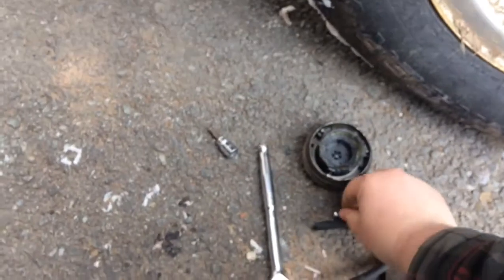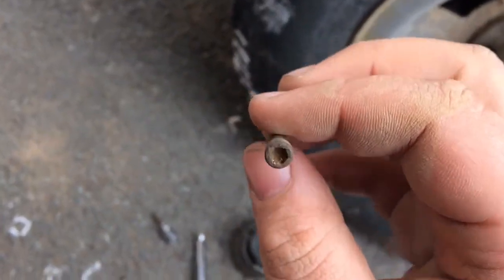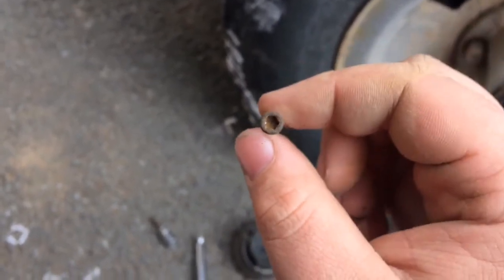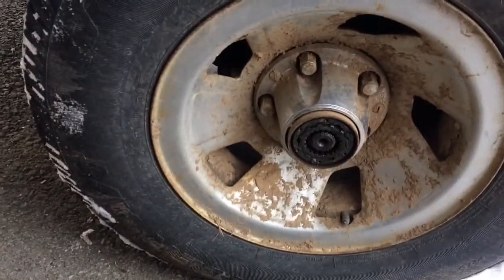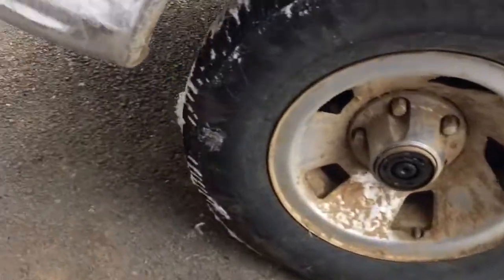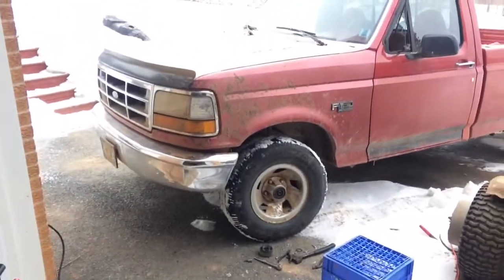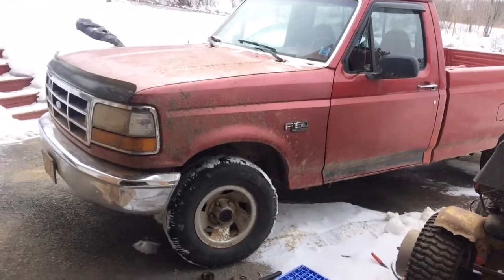But anyways, 6 bolts, T25. These ones are Allen head, but what you want to do is take the Torx head and beat it into here. That way they won't strip out. I haven't had an issue with it yet. I got my snap ring off, but it's cold as hell out here, so I don't know if I'm gonna do any more other than find out whether it's double nutted or I need the tool to take all the rotor and stuff off. I'll do that, and then that's probably all I'm gonna do today. Maybe drive 10, get the tool if I need it.